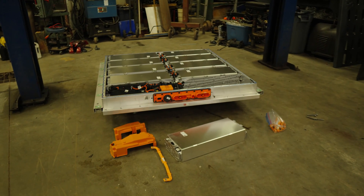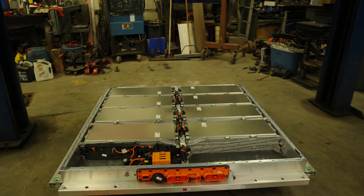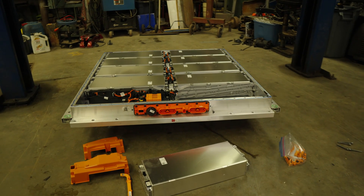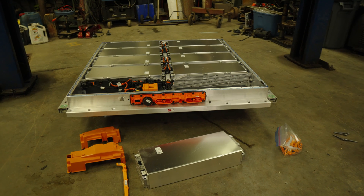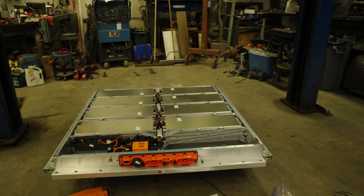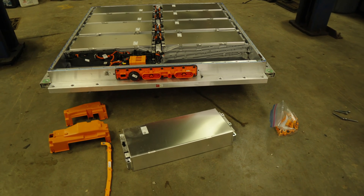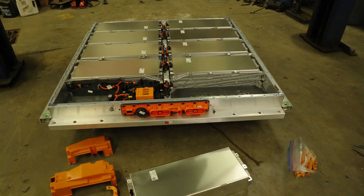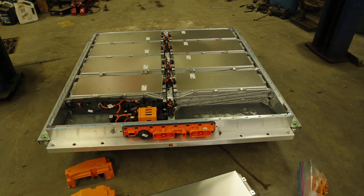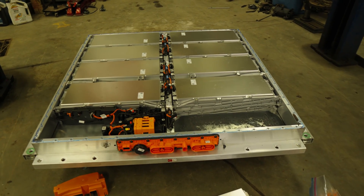First impressions — man, I like this battery. I'll put a link in the description. The last battery we took apart was the Model Y 4680, and even though they're both batteries, they couldn't be more polar opposites. That 4680 was completely unserviceable, and every single aspect of this battery appears to be serviceable. Sitting on the floor there, that's one of the modules. This is the shorter range pack — there are nine of these modules. Each module is available directly from the Volkswagen dealer, so anything in here that ever had a problem could be taken apart and serviced. There's no need to throw out the entire battery pack unless it had some sort of major physical damage.